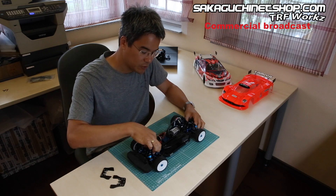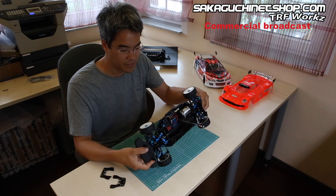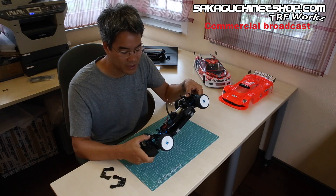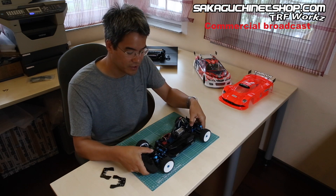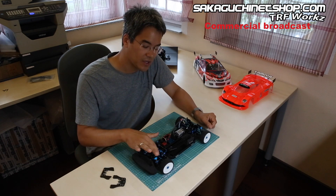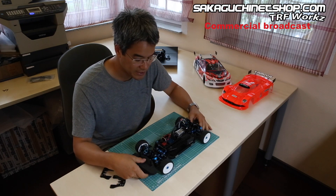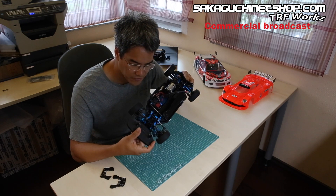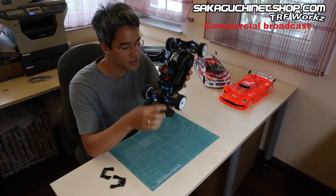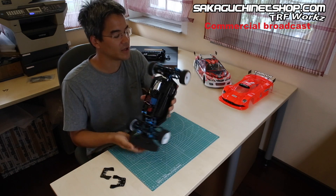Furthermore I've added the aluminum upper arm mounts — you need two sets, front and rear. They also bring a TRF-like suspension setup so you can add or remove spacers at the height of the inner links to adjust the roll center quite easily. In front I have three millimeters and on the rear I have one millimeter, while on the outside I have 0.5mm on the reversible suspension and on the rear I have three millimeters on the outside.